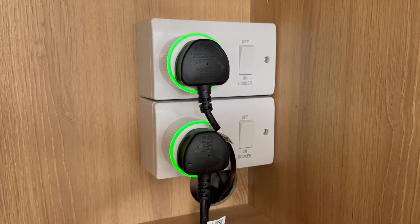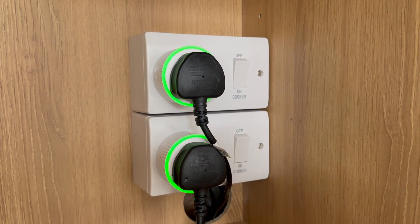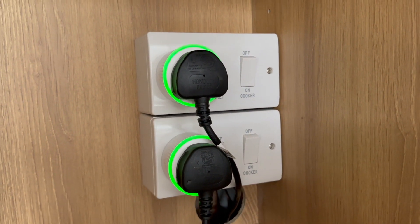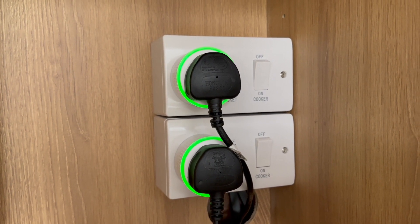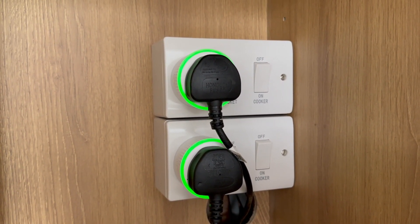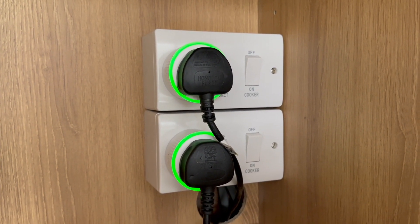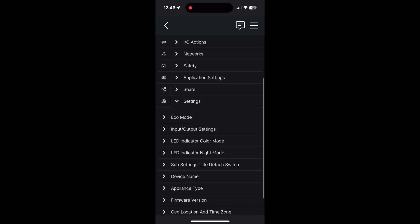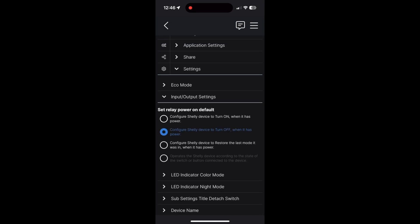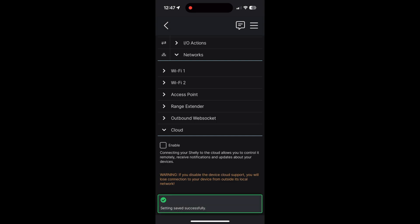Both plugs are turned on now and you can see the green ring around them indicating as much. Next I want to set them up so that when the power comes on, the plug will turn on. I'm doing that because this is for the fridge and freezer — if there's a power cut, I want to make sure that when power is restored, both plugs turn back on immediately, even with no Wi-Fi connection, because having the fridge and freezer off is bad. The first step is to change the input and output settings so that when the Shelly plug is powered up, it'll turn on — we do that with the relay power on default. Then we want to disconnect the plug from the Shelly cloud, which we get under the cloud setting and turn that off.